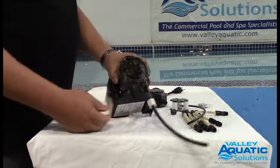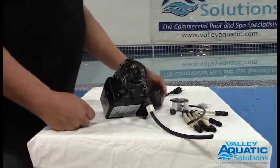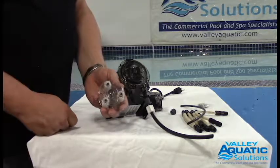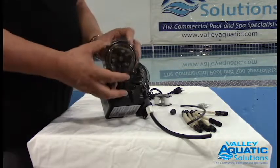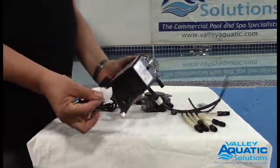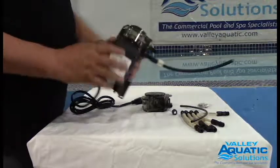Now, if you're thinking you have an old-style pump with the old head but you like this new collapsible style, it's easy to purchase a new head. I just want to show you what the old-style roller assemblies look like — again, not collapsible. To put the feed tube in, you have to utilize these half-circles here. Simply order a new head — not just the roller assembly, but the new head assembly you'll have to purchase also. And your old pump would not necessarily have this keyway in the back. So what you do is purchase this adapter, which slides in the back of the pump — that keeps the whole fan motor from moving when you tighten the pump. Thank you for watching this video, and stay tuned for more instructional videos from Valley Aquatic Solutions.